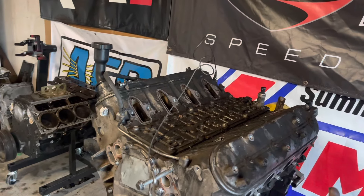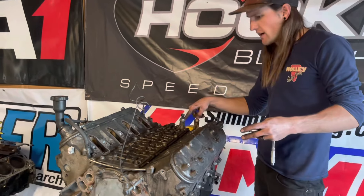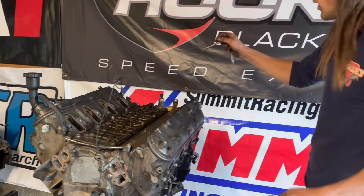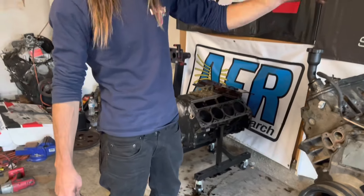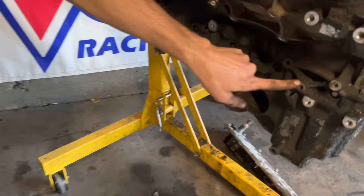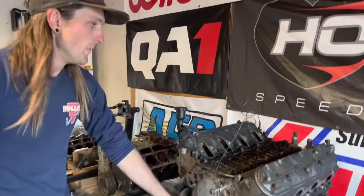Why this thing is so weird is it's a 24-tooth motor — it is not 58-tooth. Just like the 2005 Corvette, that's a 24-tooth motor; LS2 in 06 went to 58-tooth. The cam sensor is back here, but the crank sensor is up in the front just like a Gen 4 motor — but it is still the 1-tooth sensor. When they went to active fuel management, they moved it from the back up to the front, and then the knock sensors were moved to the side — Gen 4 knock sensors on a Gen 3.